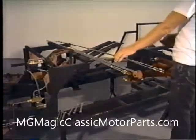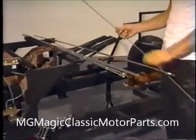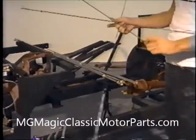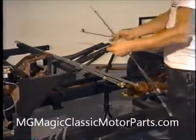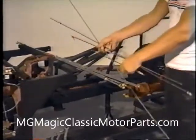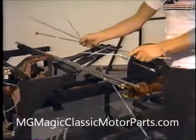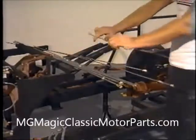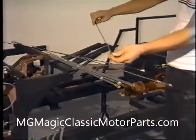When we stripped our Chevette, we left the metal brake lines attached. We have purchased new brake lines as well as fuel lines from our local auto supply store, along with the appropriate fittings to connect the lines together. For the brakes, we use 3/16 inch tubing — we need about 15 feet, available in various lengths. For the fuel line, we need approximately 10 feet of 5/16 inch tubing, and the fuel return line requires about 10 feet of quarter inch tubing. These lines have fittings on each end and can be easily bent to shape and connected together.